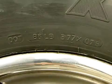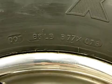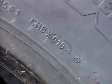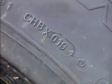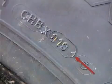In addition, you can determine the age of the tire by looking at the DOT number located on one side of your sidewall. The last digit on the right is the year the tire was manufactured. DOT markings related to the year of production may have an additional symbol for the decade of the 90s. This would be shown as a triangle following the last number.